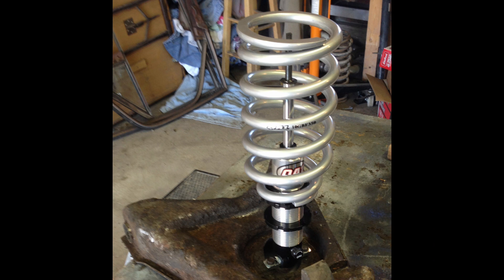We need to discuss why a coilover system is better. The biggest advantage is adjustability — you have the ability to adjust height and adjust shock pressures, which allows you to dial your ride in. The other advantage is you now have a spring system that is pivoting freely on the lower control arm. With a spring sitting in a pocket, there is some flex from side to side and it's not as smooth an action. These three factors — adjustable shock pressure, adjustable height, and better suspension action — are why a coilover is a massive upgrade over the stock system.